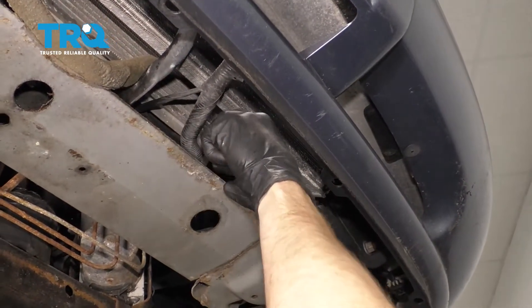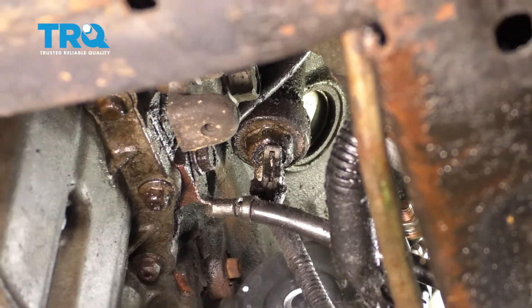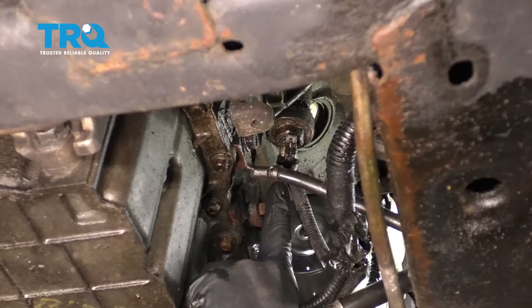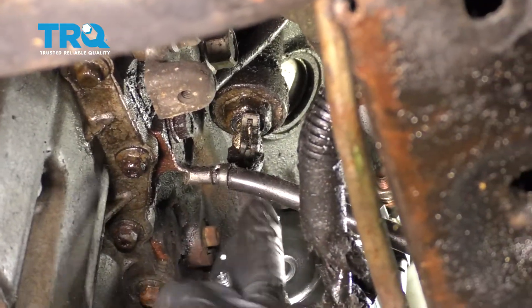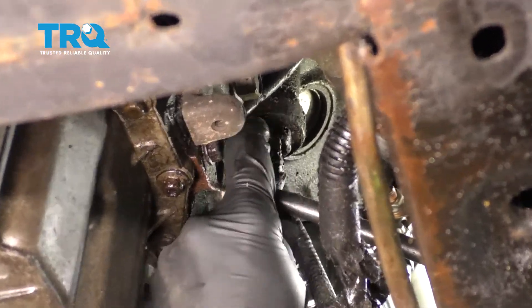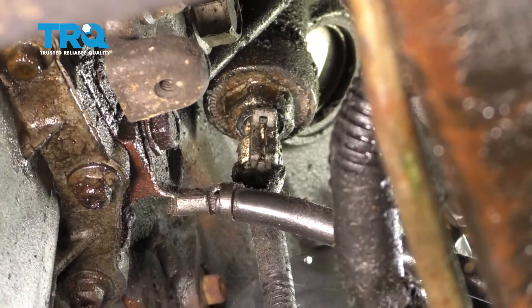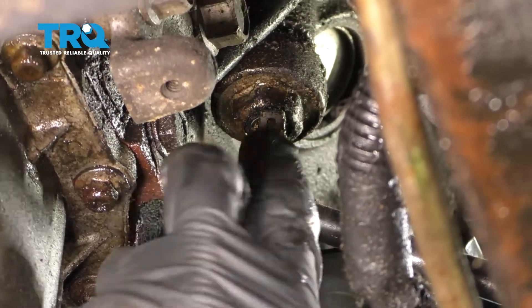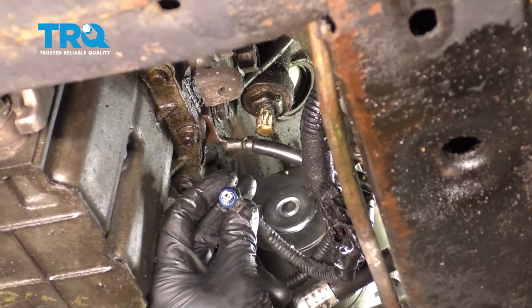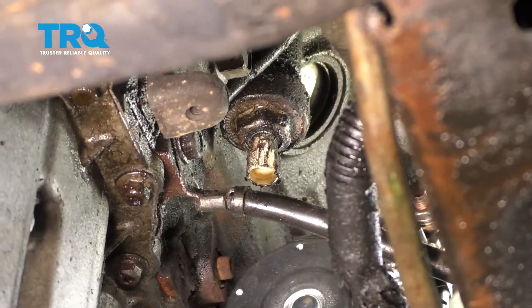Let's get our wiring re-situated and lock it in so it's secure. Now that that's drained, let's make our way up here. You're going to find your starter, and just above the starter along the backside, you can see where the knock sensor is. There's wiring that leads to it, so of course we need to disconnect it. To disconnect it, there's a little tab where my index finger is — carefully pull down on that a little bit to start pulling it apart. Every time you disconnect an electrical connector, take a peek. If you see any funny colors, it's corrosion and it would need to be dealt with. This one looks fine.